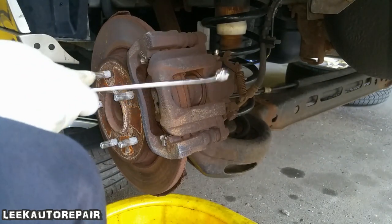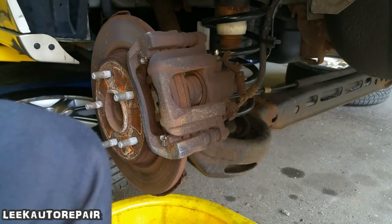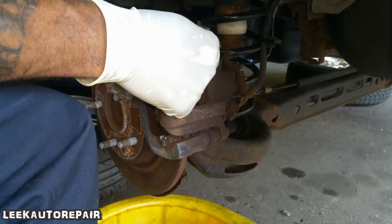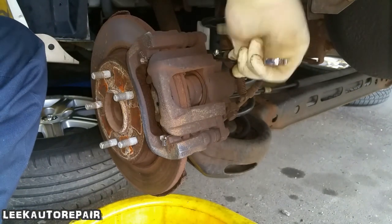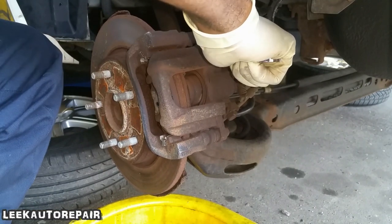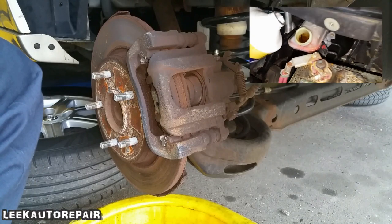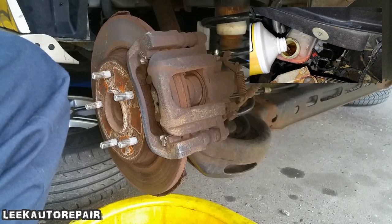When you're bleeding brakes, we're going to start from the left rear wheel — that's just the procedure, it's always been done that way. Follow your fundamentals. There's a bleeder screw right here — grab an 11mm wrench, or if you've got special tools for doing brakes, you can use that. You want to crack it free, make sure it comes free, then just tighten it back up. Make sure you've got brake fluid in the reservoir — keep it topped off at all times every time you bleed a caliper. I've topped mine off already. Next, pump the brakes until you get some type of pressure.